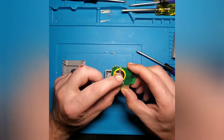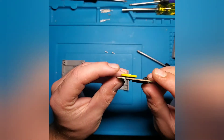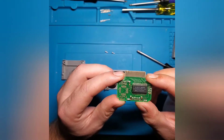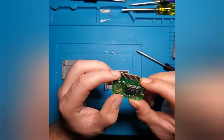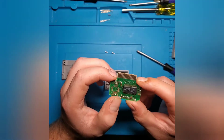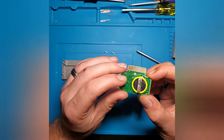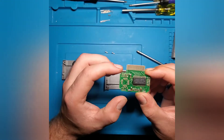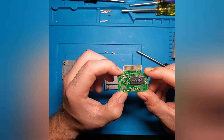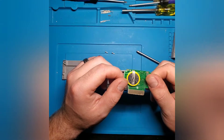As you can see, there is a strap that goes over the top and another strap that goes to the bottom. Now this battery is actually soldered onto the board itself — the two contacts are here and here, and you actually need a soldering iron in order to get this battery out. There is the possibility of putting in a battery holder like what's in the bigger versions of these memory cards. However, there are fairly cheap replacements for these batteries that come with the tabs already on them, and all you need to do is desolder this battery from the main board and then solder the newer battery back into place.